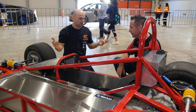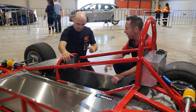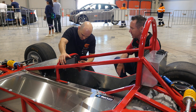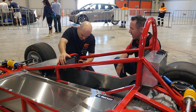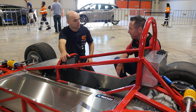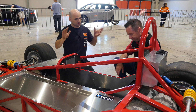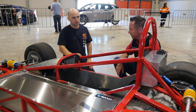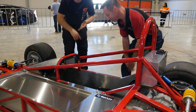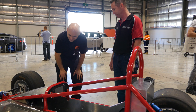You might be controlling regen up and down? Not really, because at the end of the day it will mess with the biasing. The brake biasing knob is just here - you can adjust your front to rear bias. But your regen will actually cause you a little bit of drama with your biasing. Set and forget. We just run a few laps like this. Life is much simpler with electric - no gear shifting, just push and go. Because the throttle is all about torque control.